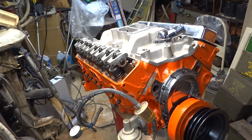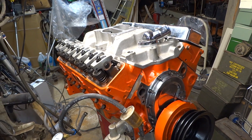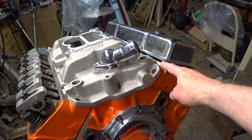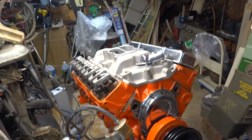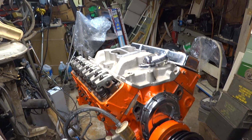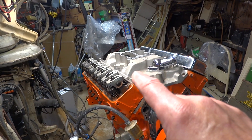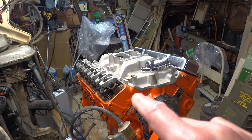This sure would look pretty with those roller rockers on there, but if I put those on I have to buy a new set of valve covers because they don't have enough clearance — you can see there's a gap right there. So it will be going back with the stock stamped rockers. I'm sure these would gain me a little tiny bit of power, but it would only show up on a dyno — you couldn't tell sitting in the car.